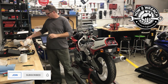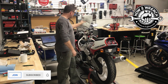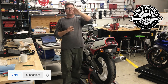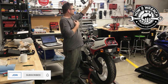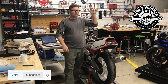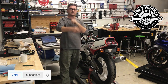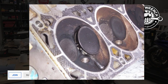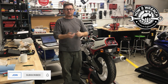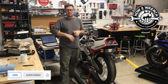What I do when I store a project is I plug the intake manifolds — that's number one. Then I take a towel and had it wrapped all over the bike. A big reason is that during the downtime when I was running new airlines through the ceiling, ceiling dust was coming down. Who knows — if you pull a tile, an old screw or fastener could fall and you don't know where it went. The last place you want it is in an intake, because when you hit that starter button, if a screw sneaks past a valve and gets between the piston and head, you're going to have a major problem. You could bend a valve, hurt the piston and head — it's going to cause you to tear the engine apart and have thousands of dollars of trouble.